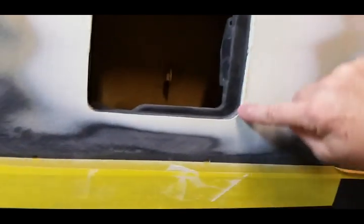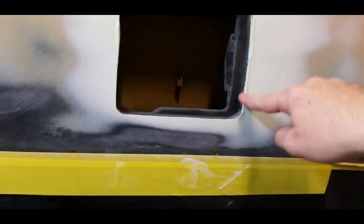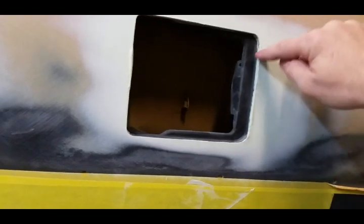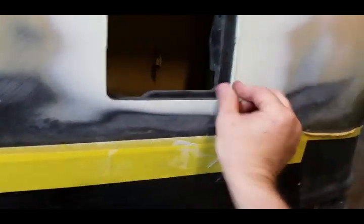I've got a little bit more finish work to do around the edge. I had the gas door on when I wiped everything, so it had filler down on the inside. I had to take a knife while it was still kind of soft and work my way around so it didn't bond itself. After it got sanded there were little bitty edges on the spot, so I mixed up more putty, dipped my fingers in it, and did it like that to get a nice 90-degree fill. Of course I have to go back and block this now.